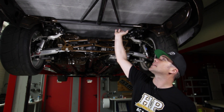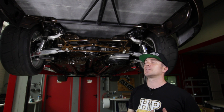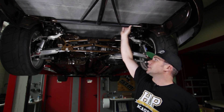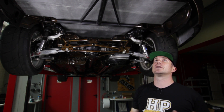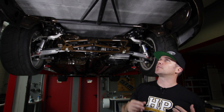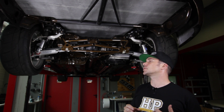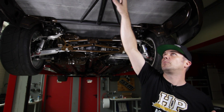Lastly under the car we have this custom mount for the parachute — something you're only ever going to find on a drag car. Once you get up to around 150 miles per hour, most governing bodies require a parachute to help slow the car down. This chromoly bar ties the two pieces of the rear subframe together, extends backwards, and makes a nice safe secure mount for the parachute. One important factor is the height the parachute bracket is mounted relative to the axle line. Because there's not a lot of weight in the back of this car, it can be quite easy for the chute to pull the rear end off the ground if mounted too low — so we need to make sure it's mounted high enough to prevent that.